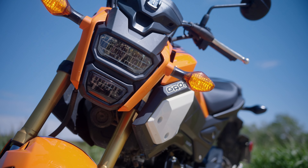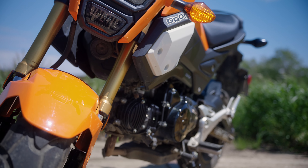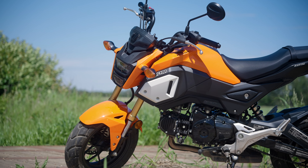So I think that's really the take-home with a stage two kit — I can't really say it's going to make the bike super fast, but it just gives you a little bit more consistent power. Now these bikes are like Lego and you can do anything you want to them, but once you start changing the internals past stage two, like a higher compression piston, all of a sudden you're adding more heat to the engine, then you need an oil cooler, and then the extra power you're fighting with the weak parts inside the engine. So it really becomes an expensive game of whack-a-mole. If you want a faster bike to go down the freeway, just buy a faster bike. If you want to have a little fun and put some parts on, it's going to make a hell of a lot more noise with the stage two, you're going to have a better power band, and yeah you're going to get a little bit more horsepower, but don't expect a ton.